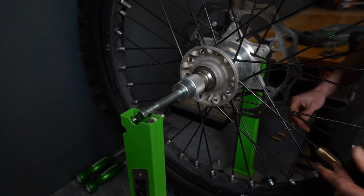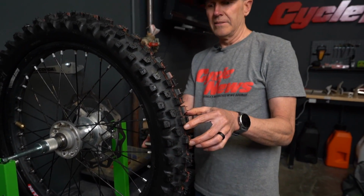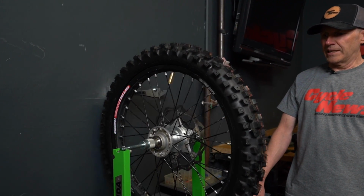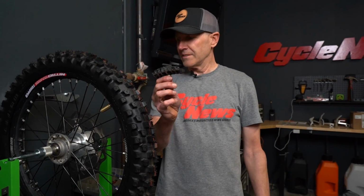I actually went ahead and started off with a weight on there because I knew I needed to offset where the rim lock is. But even with that extra one already on here, you can see that rim lock's going to fall to the bottom. When you look at how much weight there is in one of these things, you're basically trying to offset that as a starting point.